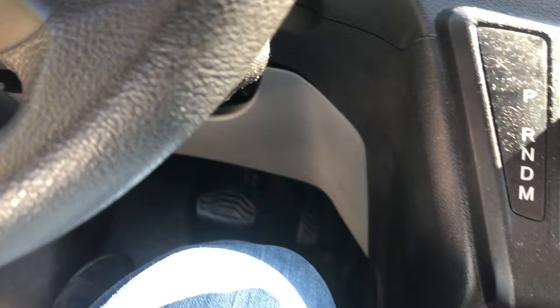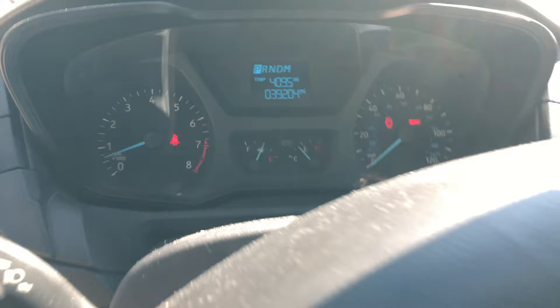To turn it on, I'm going to press my foot on the brake, then reach down here, press this button, and raise it until it stops — like that. And as you can look up on the instrument panel, you see right there it says 'brake,' indicating that the parking brake is on.